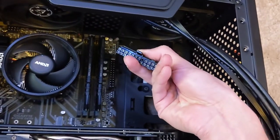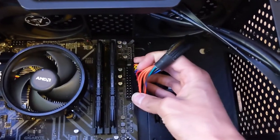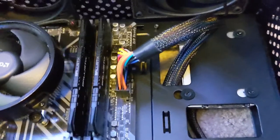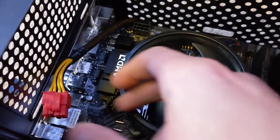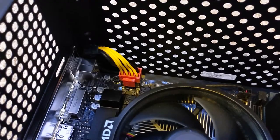Now we're back at the front. I laid my case down flat onto the floor so that this is easier to clip in. This cable has a little clip on one side, and you'll notice the slot on the motherboard right here has a little lip on the end — that lets you know the correct orientation to socket this in. So I'm going to align it and clip it down until I hear a click. Don't be too afraid to apply a lot of force here; the motherboard can bend without breaking. I ended up removing my top fans for this next step because it was interfering with the CPU power cable. I'm going to grab this cable, move it over to the top corner through this little hole, and then route it to the front of the case. Like the other cable, this one has clips that secure it to its socket and I'm going to press it down until I hear a click again. After some fiddling around, I finally got it in.